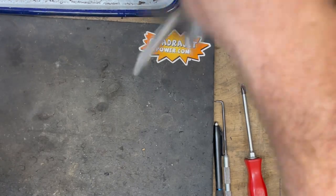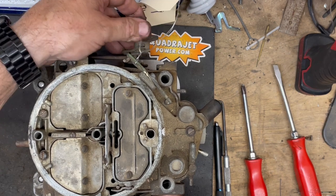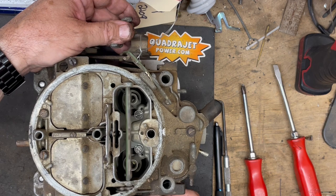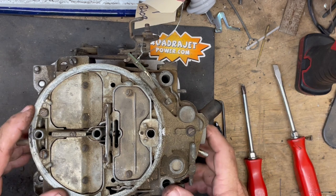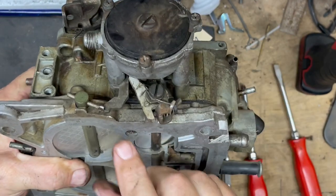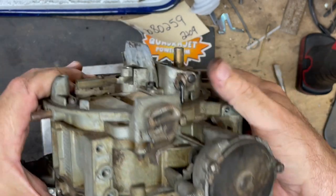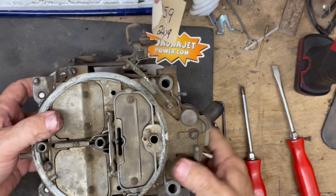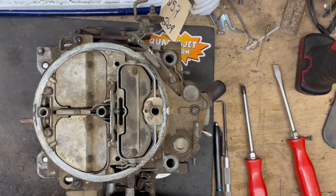The choke is in place. We're going to make sure it's got enough tension to close the primary flap just slightly, so it's easy to move. While the choke is on and activated, I'm going to look down here and see that the secondary lockout is in place and would function if you want that ability. Everything's connected, everything's in place — we'll tighten that down.